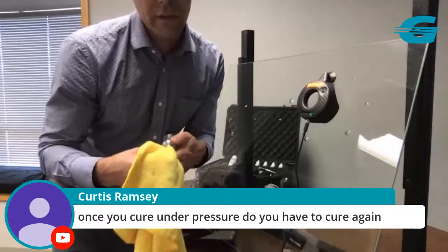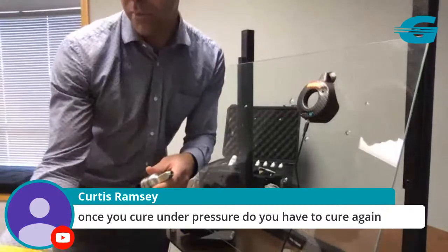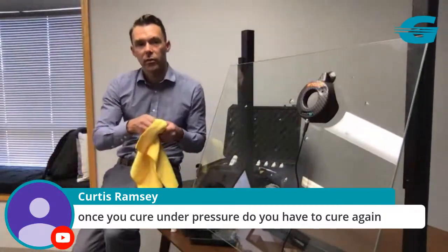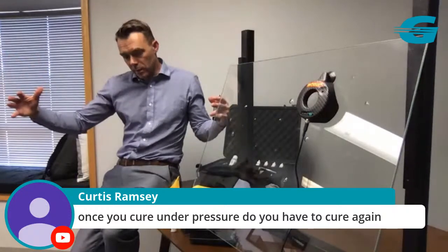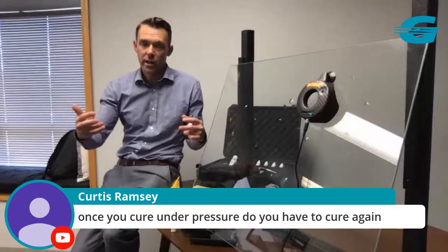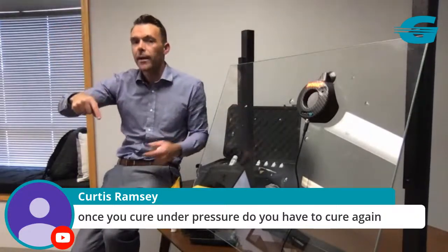And then, so Kurt has a good question. He says, once you cure under pressure, do you have to cure again? So the purpose of curing under pressure is that the outer shell of the repair itself, especially on big bullseyes or combo breaks, as the resin cures, it shrinks slightly, right? So we want to avoid that. That's where the ProCure comes in, because it's flash curing that resin so that it prevents it from shrinking away from the outer shell.